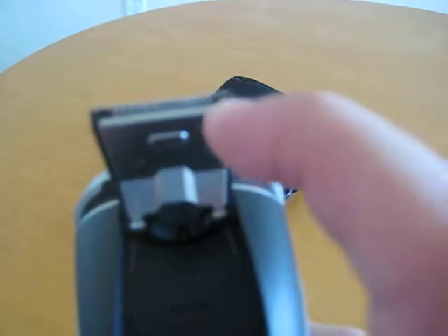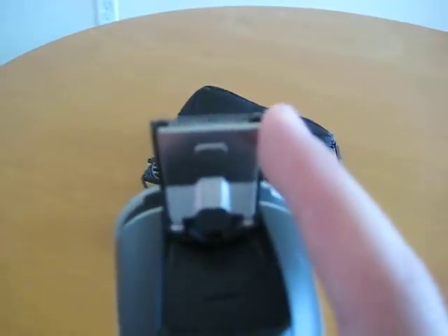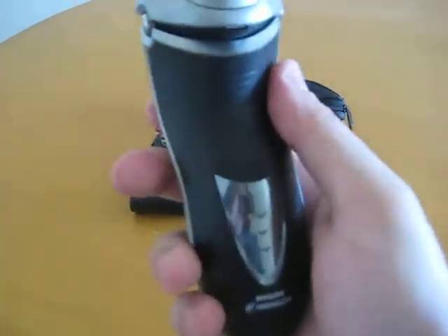The way I've been cleaning this is with small scissors. This little silver plate pulls back a little bit, and you can put small scissors in there to get some of the hair out — you could probably run it under water as well, then just tap to get the stubble out. I do notice it works a lot better if you clean it regularly. Just as general information: if you're using a trimmer on your facial hair, try to clean the blade regularly and it really functions a lot better. It doesn't make the battery work as hard if this space is clear.